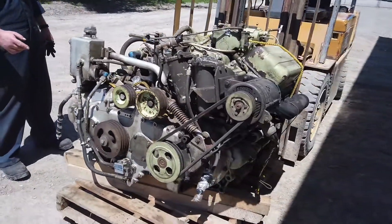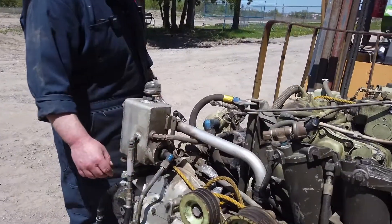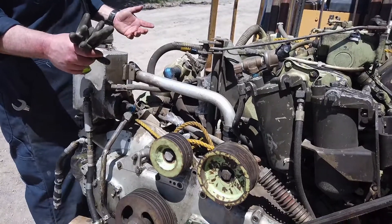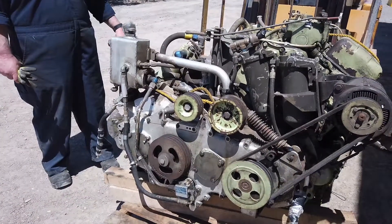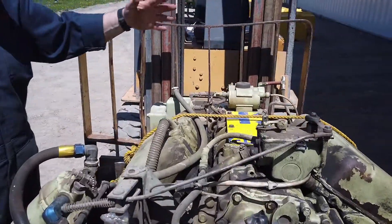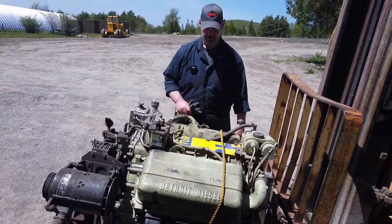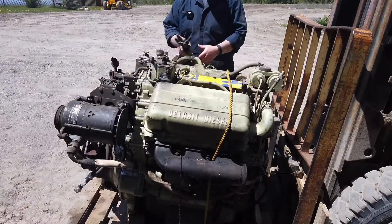They can do their fuel checks and oil checks. You've got the engine dipstick and transfer case dipstick here. This is your transfer case. You have a transfer case disconnect so you can essentially put the vehicle in neutral if you need to tow it for a prolonged period of time. There's a fuel filter, and where your air intake goes — if I was standing on the driver's side of the vehicle, you'd have your air intake coming here and your air cleaners inside the engine compartment. On the far side on top of the engine you would have the radiator and the fan drive for cooling going out through the top of the vehicle.